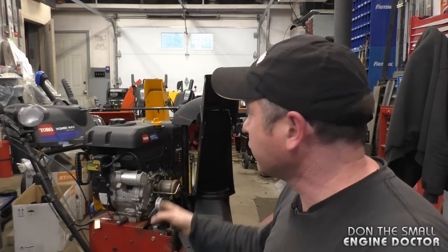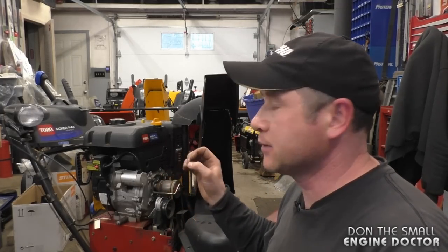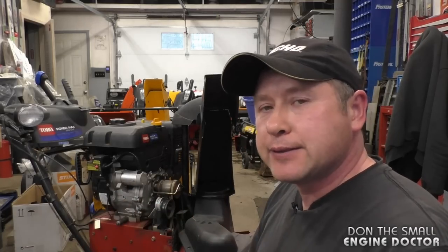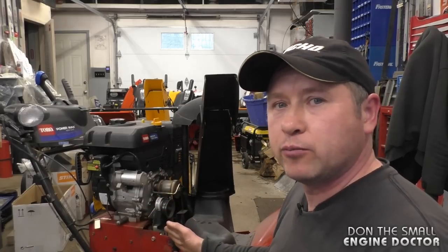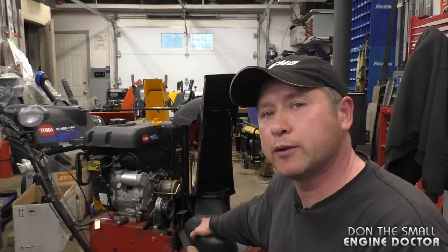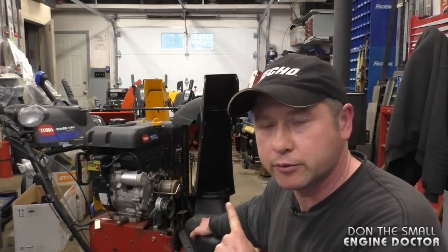Now if you still have surging after doing what I showed you, what you want to do is meticulously clean your carburetor, put it back together, and make sure the jets are clean as well. If it still surges after you've cleaned the carb and enlarged the jet, I recommend replacing the carburetor with preferably an OEM carb. I've put a link in the description to the video I made last summer of me doing this on a lawnmower — check it out because you may have similar issues with other equipment. I've also put a link to where you can buy the micro drill bit set. Thanks for watching — make sure you're subscribed and following me on Facebook, Twitter, and Instagram. All the links are below. Have a great day!